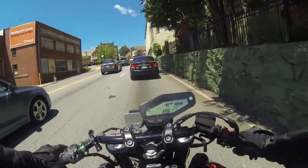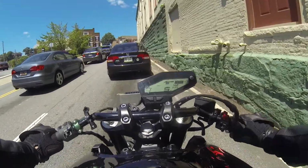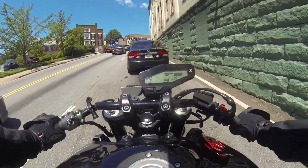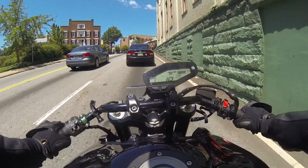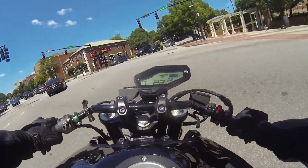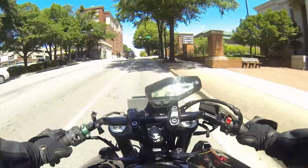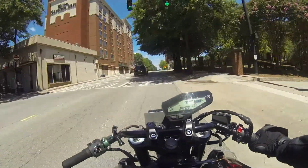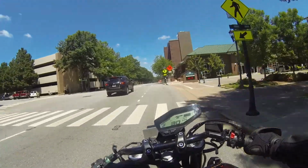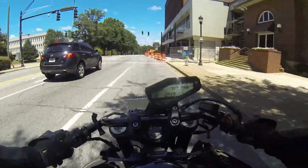Most slip-on exhaust systems are actually designed for that particular model, or the piping is designed to fit that model. The exhaust, intake, and combustion all have to be in a certain range of each other for it to all work and function how it's supposed to. So when you get a slip-on exhaust system, it's not just put together and made to fit. It's actually designed to run with your system. So being the fact that I'm going to make a custom one, once I've got the custom exhaust set up, I can then go do my tune without any of the air injection system or the O2 sensor getting in the way of doing the true mixture readouts.